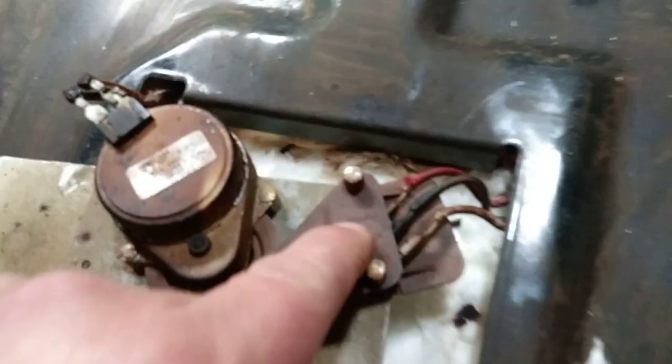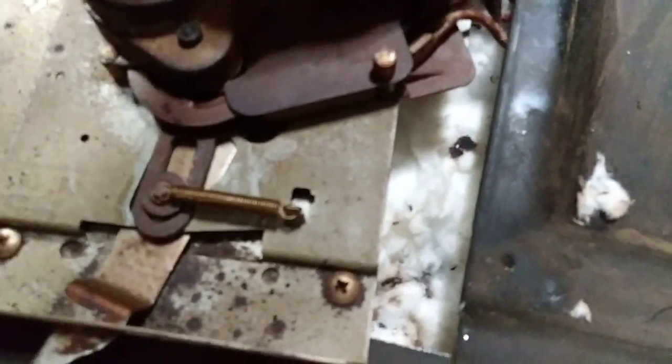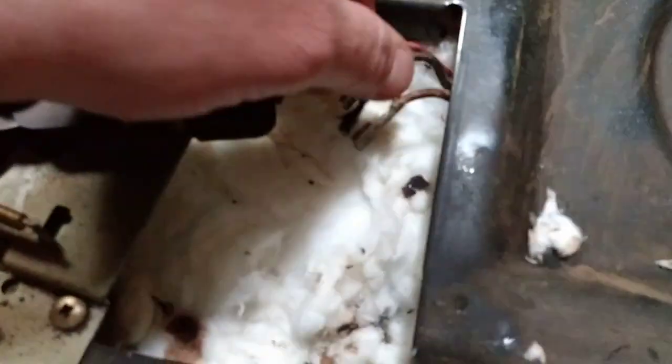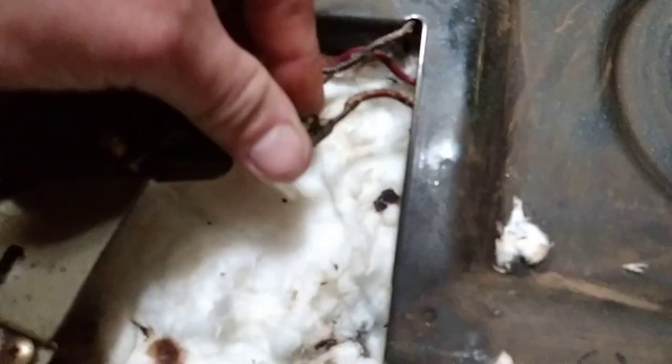I don't know if I can get a good clear shot in there, but there's writing on here. It says: unlock, common, and lock. Well, you don't want it to lock — you don't want it to run up to 500 degrees. There are three terminals. What I've managed to do is unplug each and every one of these. So essentially, what you're going to do is take these two wires — this is the common and this is the unlock terminal — and all you want to do is plug these two together.